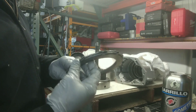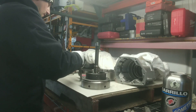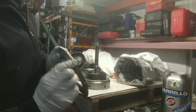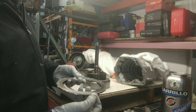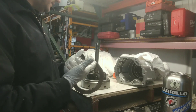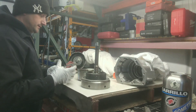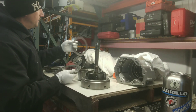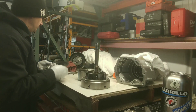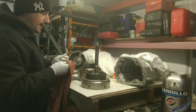These lugs grab the drum. Why is that important? The more you have engaged in the drum, the less force is put on each lug. Originally when I put this together I put the thicker ones in because I wanted it to be wider to absorb the heat and I wanted to have all the tangs.